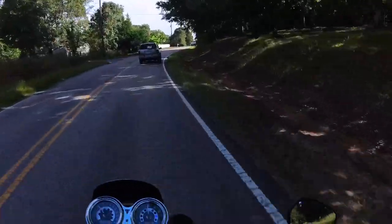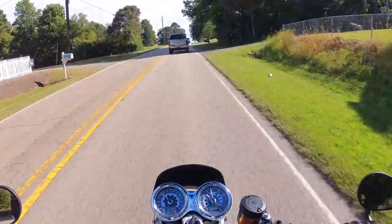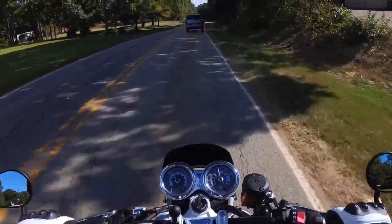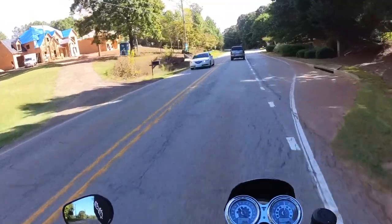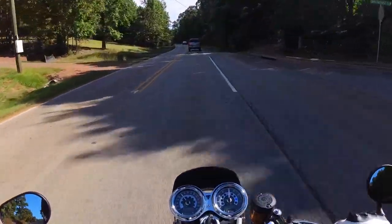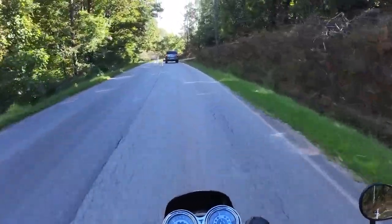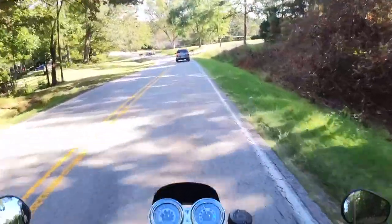And I'm trying to think of how low the tread was on the other tire. Okay, maybe there was 3 millimeters off of it? And just going to a new tire? Or is this tire... This tire looks a little narrower, even though they're both 160/60s. It looks a little narrower than the stock tire, but I think it's a little bit taller. And I'm feeling it want to just poof into the turns quicker. It feels great once it's there. It feels very planted. But I definitely feel like my rear end is higher up than it was. I've not adjusted the shock ride height. I left it stock.